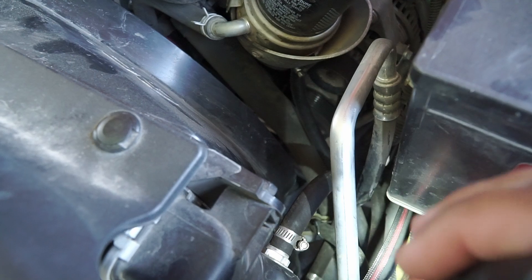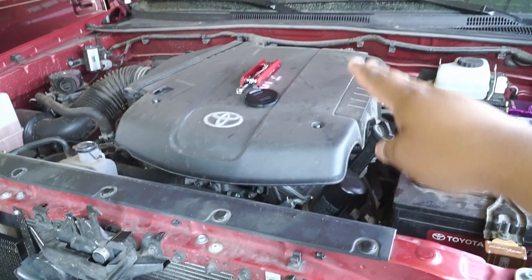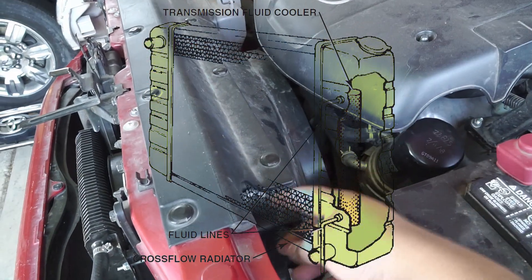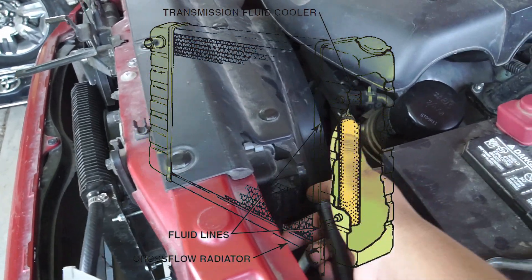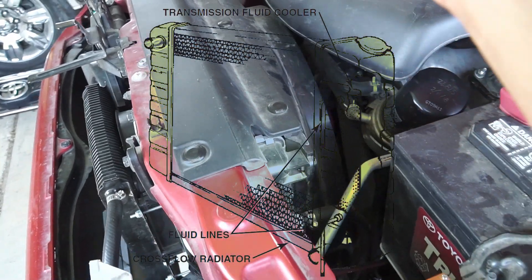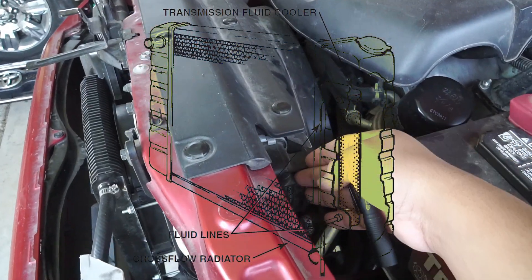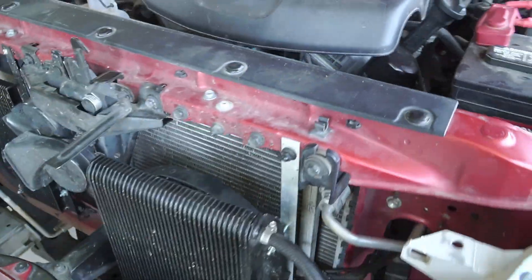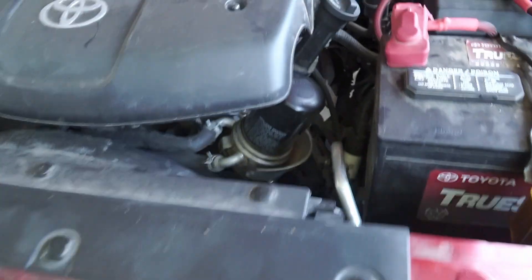It's handled that without problems. It's able to keep the pan at 160 from the factory, and this is just about any other vehicle on the market. As the oil is coming from the transmission located on the back, it comes to another form of cooling — it comes to your engine radiator cooler. There is a small tank, I think it's a copper tank, inside this plastic, here on the opposite side of where the coolant comes from the engine. There is a built-in cooler in here, and that's how your transmission is able to cool on most vehicles. And what I did — I bypassed that system.